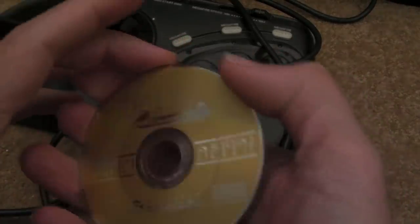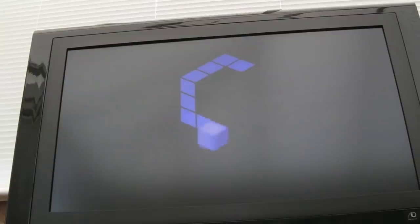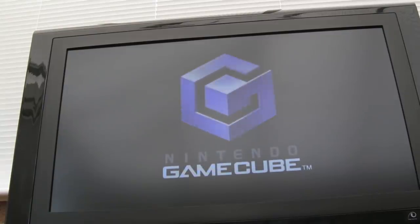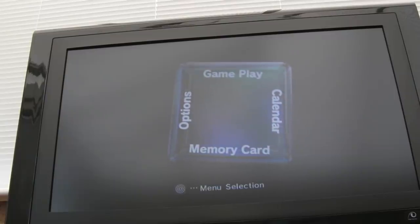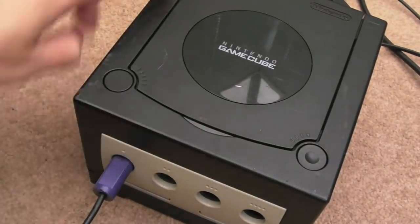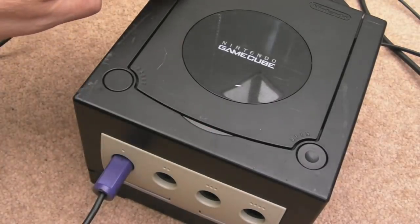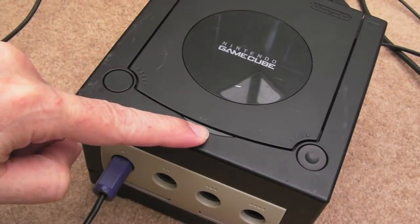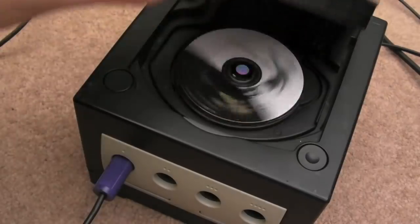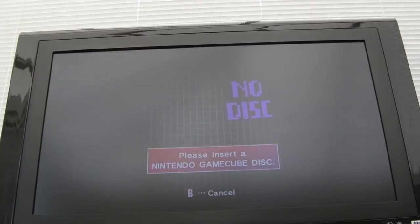The disc that was already inside was Zelda Wind Waker, and it's pretty scratched up — that needs resurfacing. So trying it with my Resident Evil Zero. Yeah, it's not doing anything. I'm confused by that LED actually — this was on originally when I first switched it on, it lit. I think that's the power LED, but it might be the drive access LED. It's just weird how the first time we switched it on it came on, and now it's not on. It is spinning, so it's having a go at trying to read the disc, but it's not seeing the disc. So it's going to be a drive problem on this one.